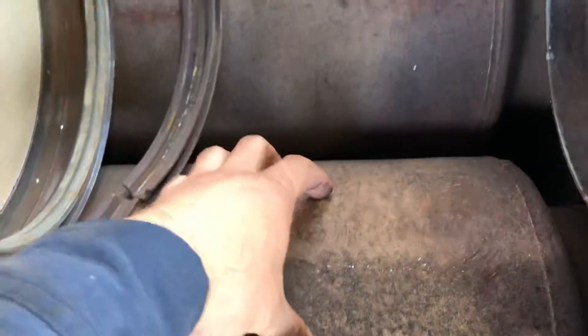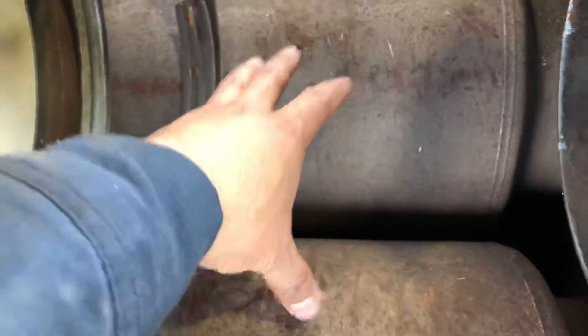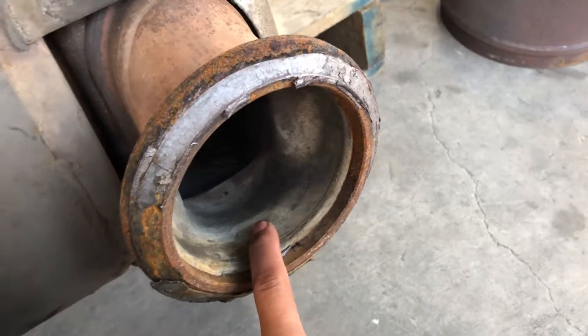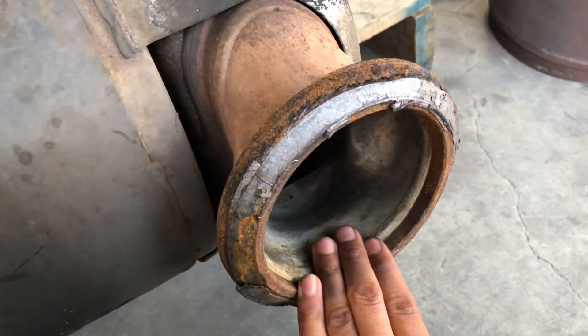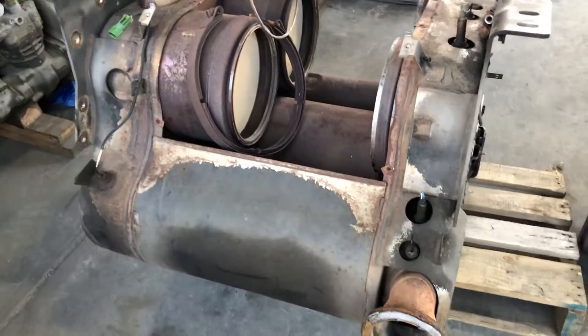These two things here are the SCR panels where the conversion occurs between the ammonia and the exhaust gases — I'll cover that in more detail in another video. With the heat, this is where the reaction takes place. It should come out free of soot. If you can see something dark like soot, or you can see oil or fuel, you have a really big issue with your filters and pretty much with the engine.